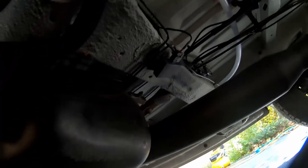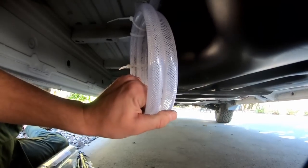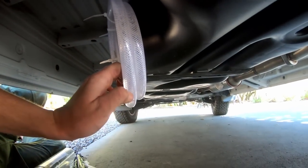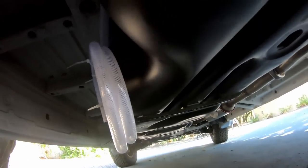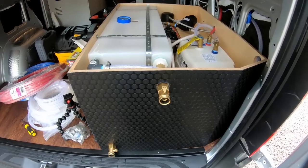The gray water drain from the bottom of the sink comes out of the drain plug on the body panel, gets weaved around back to cross the van underneath where the factory wires are, and for now is coiled up and zip-tied to one of the factory mounts on the body. This routing stays very far away from the hot exhaust and has no kinks. The braided vinyl tubing used here is ridiculously strong — I tried to cut it with my sharpest knife and had trouble — so it's definitely the right material to use underneath the van.